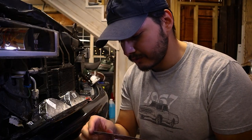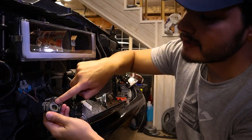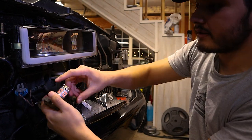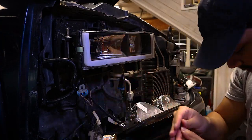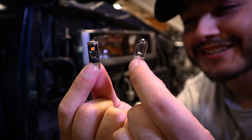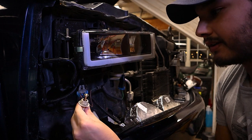You can go ahead and do the turn signals as well. This is just a normal halogen bulb — all you're doing is twisting it and popping it out. You'll see it has two little anchor points and a small notch that lets you line it up with the indentations in the housing. You just put it in there, squeeze it, and twist. The last thing is the parking light — pretty simple, pretty small, you just pull it out. Here's a quick comparison: one is very high tech, the other is just a basic bulb. They have the same profile so you just squeeze it in.